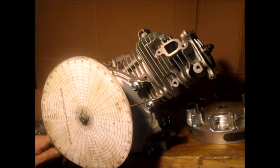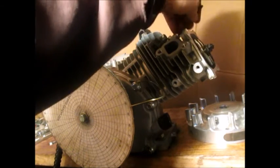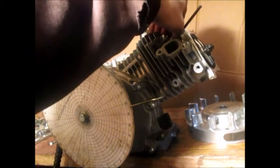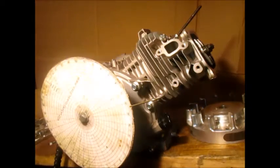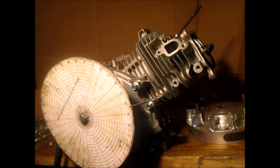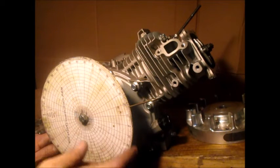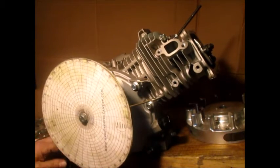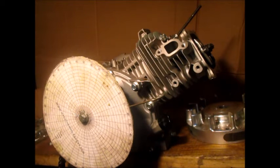I turned it back down about 50 degrees just to clear the piston stop when I install it so I'm not screwing it into the top of the piston. You can make your piston stops out of old spark plugs — I found that was way too much work, so I went to the store and found something with the same thread pitch as a spark plug and just put a piece of all-thread through it with a nut and bolt on either side, works really well. Now we rotate the engine back towards zero and see where it stops — right here it stops at 17 degrees. Then we rotate the engine back the other side and again it stops at 17 degrees.